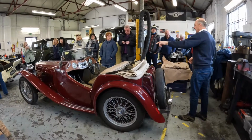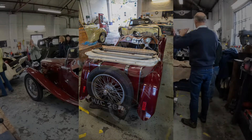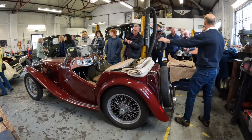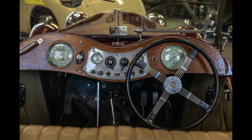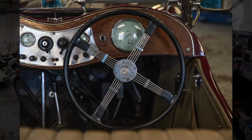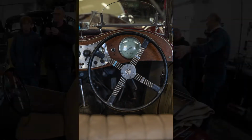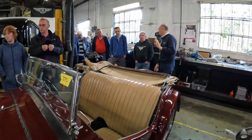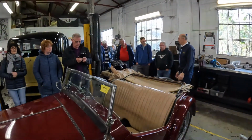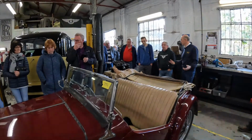And the prop shaft's sliding joint hasn't been greased in years, so it's dried out and that's also worn. So you've got all this free play all the way through the drive line. Every time you take your foot off and put it back on again, it's a massive amount of clonk. So that's what she's in for. We're taking out the back axle, stripping that down, and sorting out all the bits. We'll get a new prop shaft for it, or it may be a case of having one made. There's a place just outside Glasgow that'll do that, and they'll balance them for us as well.